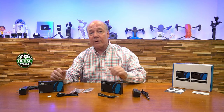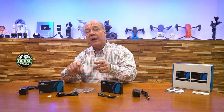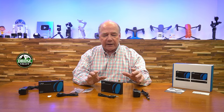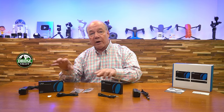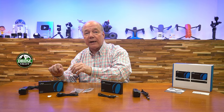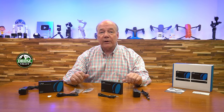The product also provides audio extraction capabilities at the remote end that will digitally strip the audio component from the media stream you're sharing and allow you to pass that along to a soundbar or home stereo for better quality audio. The transmitter provides local loopback functionality which allows you to enjoy the content here while you're simultaneously sharing it with your remote location. The kit even includes a set of infrared blasters that will collect the remote control signals from that second location and pass those back over the same coaxial cable to the primary location so you can remotely control the content you're watching.